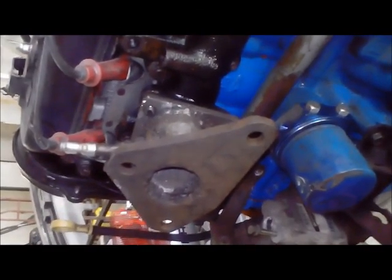The other thing I did do — you'll have to excuse this adapter I made from years ago. I put this in not knowing what I was doing — it should be after the turbo, so it's held in there, it's stuck, can't move it, staying there now. But just this little bolt in here, I couldn't get it up because the weld was holding it back, so I just ground that back and now that should go in okay. That's the adapter for the TD-04.